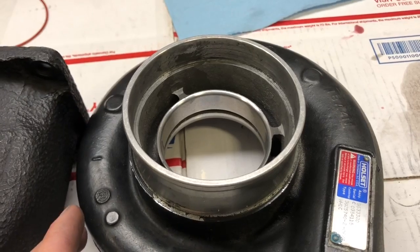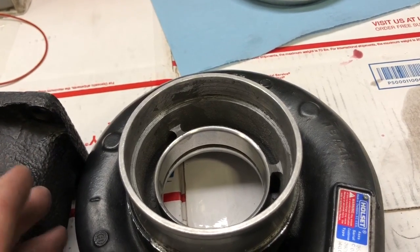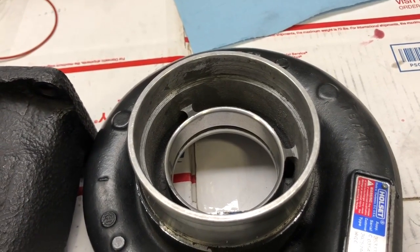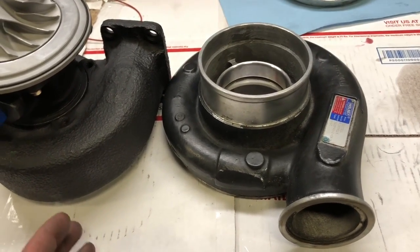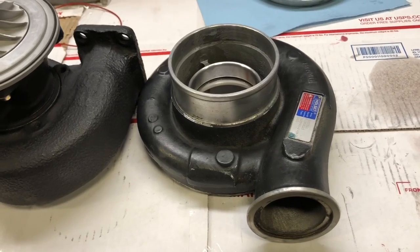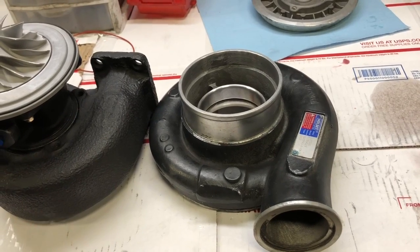One thing you'll notice on a lot of H1Cs is that some of them appear to be cut for an anti-surge groove, but most are not. The purpose of the anti-surge groove is that if the turbo is compressing more air than the engine can handle comfortably, that groove allows it to relieve pressure back out so you don't over-compress the engine. Especially on units without waste gates, they can't control the pressure being pushed in. Since diesels usually didn't have blow-off valves, the anti-surge groove provides a way to relieve compressor-side pressure without a blow-off valve and without a waste gate actuator controlling exhaust-side pressure.